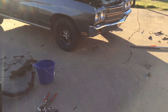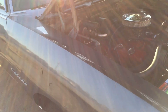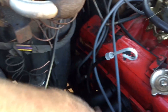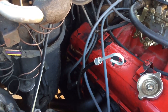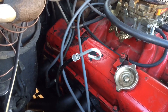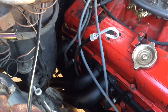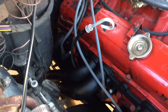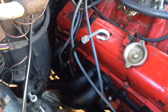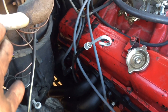I was having some technical difficulties with the headers and my phone. I ended up having to drain the coolant. You remember that switch from the last video where we removed the wiring for the transmission controlled spark system — that thing was too big to allow the headers to drop into place, so I had to pull it out. Luckily I had an Allen head plug in my shop, so we were able to drop that in, bolted up, no issues. I also removed all the spark plugs so I didn't break one off — they're all back in. I got all the plug wires; I know they're mismatched right now, some are too long, some are too short.